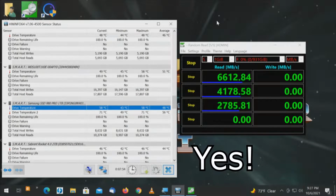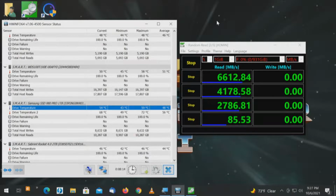I mentioned that firmware update because if we were using this drive on, say, the X570 chipset specifically, if the drive is on a motherboard that has the X570 chipset, but if the drive is connected to the CPU, it would not be affected by that performance degradation. However, if it's on the chipset, which is a little bit slower, it would be. And for some reason, something is affecting performance of the WD Black on the Gigabyte Aorus. And my only solution is the firmware update. We should not be having a load balancing issue. That's why I kept 4 drives on the card. However, you see the numbers.